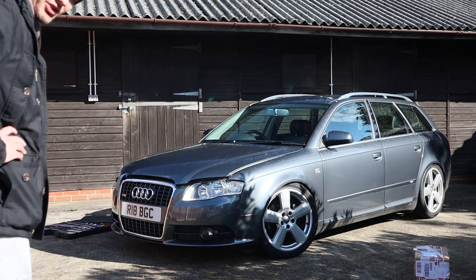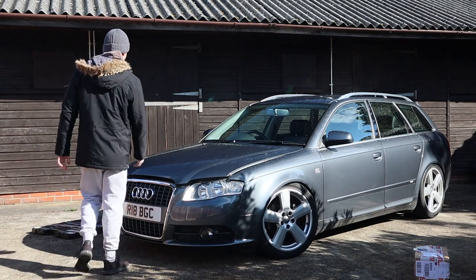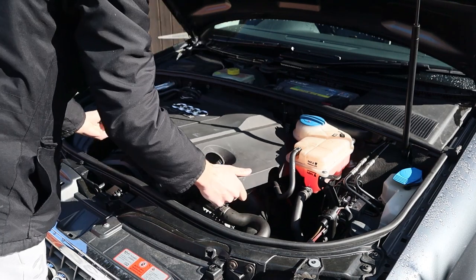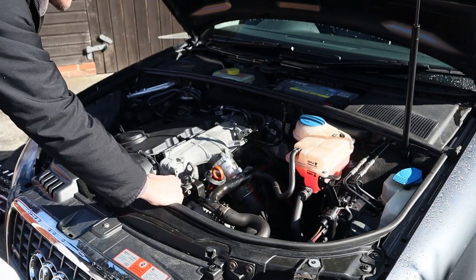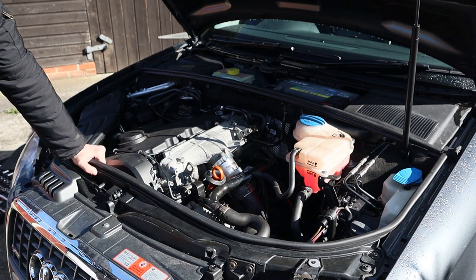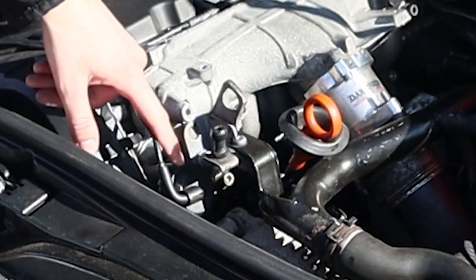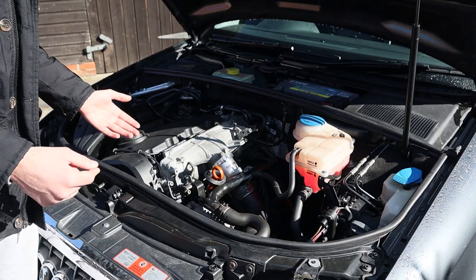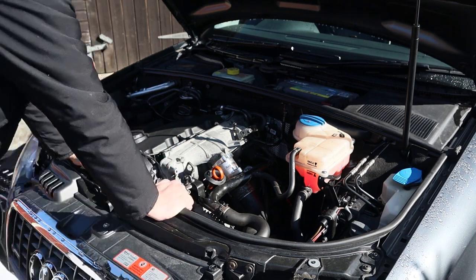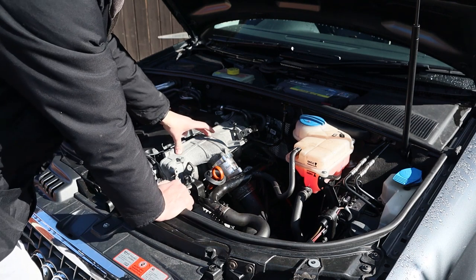They also cover the engine in a massive oil mess. Let's have a quick look and try to locate where they are. I only know this because when I bought the car, the previous owner said there was a big problem he was going to fix before selling it - the little vacuum module which opens the flaps had a split in it. It's a common fault. My engine is once again down on power, so I'm not really sure what's going on, but the intake manifold flaps are somewhere in here.